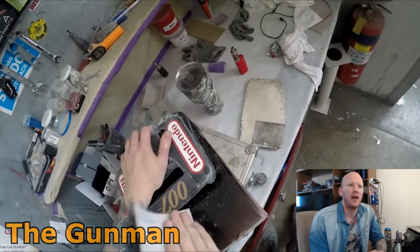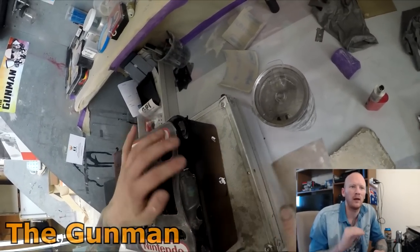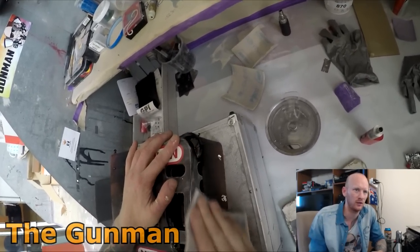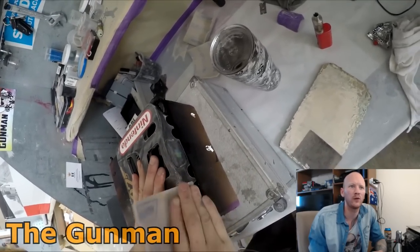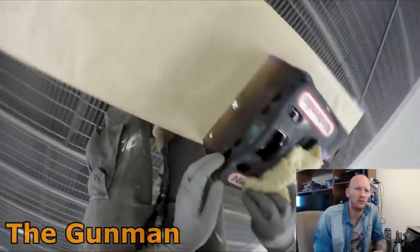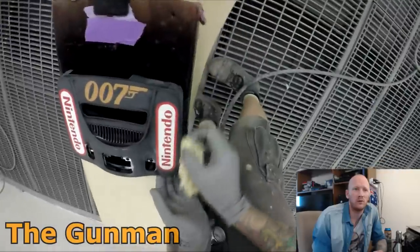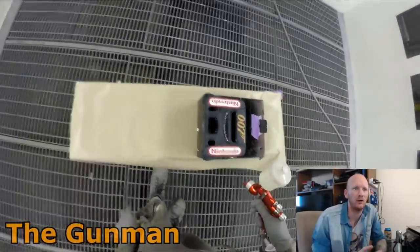So yeah, just using 800 grit here, and I gave those logos and the areas that got the stencils just a good extra sand down to make sure it's nice and flat for when we give it the flow coat. Got it in the booth there, tack ragging it again, sped the footage up a little bit here just to get through that vid. I didn't even wax and grease remover it before I flow coated it, and as you'll see in a minute, it's clean.